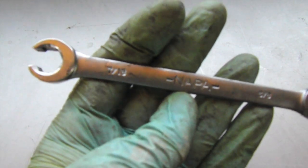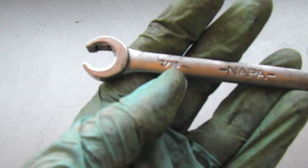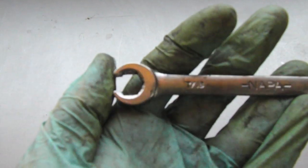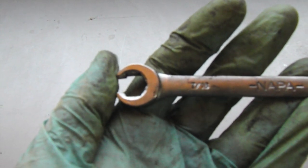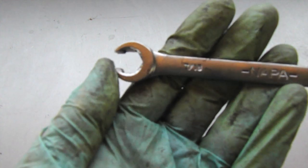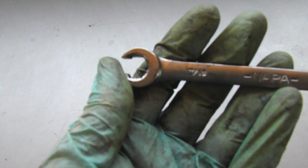When I tightened down the brake line, I used a line wrench. I don't have a metric version, but the 7/16 worked on this particular brake line. The reason you use these is so that you don't have the chance of stripping out the head on the connector like a normal wrench might. So it's recommended you use one of these if at all possible. But if you're gentle and easy with a normal wrench, I've also gotten away with doing that as well.